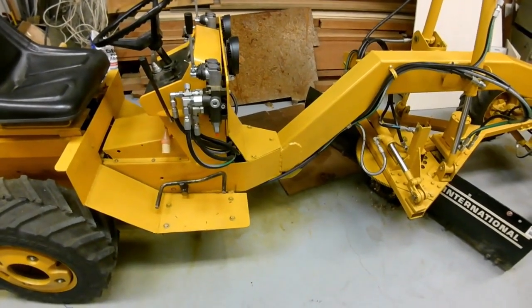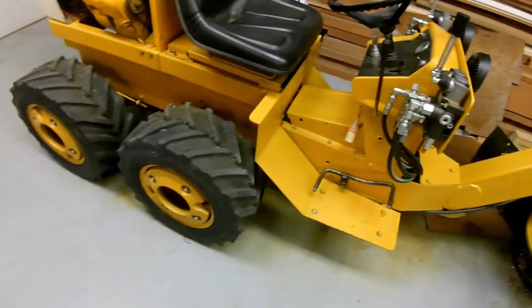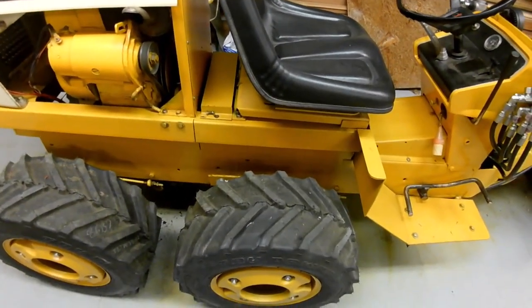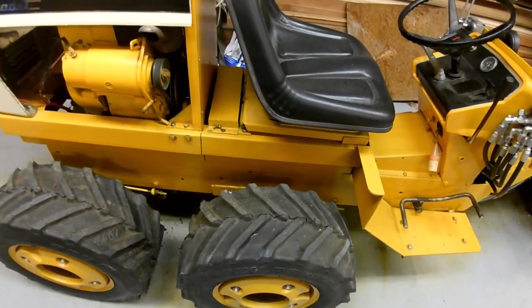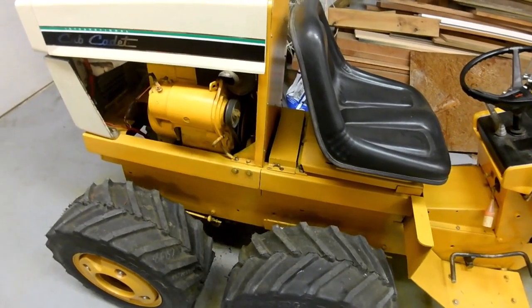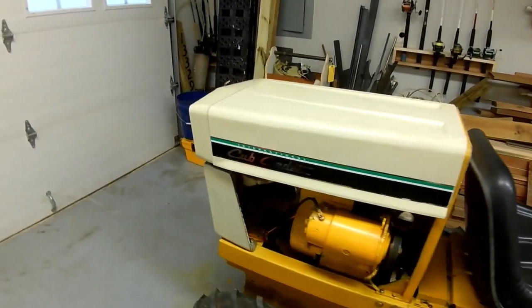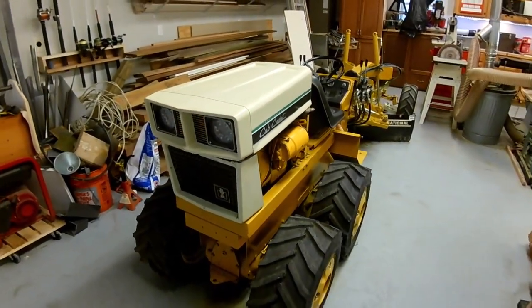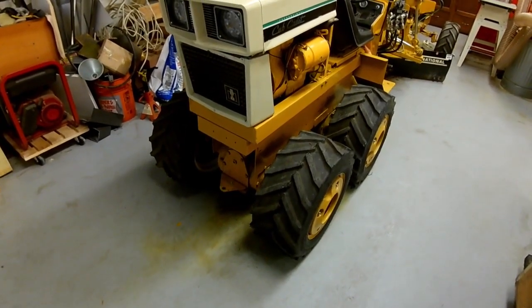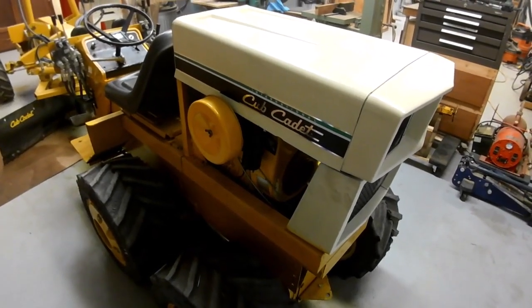The dash tower and dash are retained from the Cub Cadet, and from that point forward it's all been custom fabricated. The wheel wells and footsteps are custom fabricated. The original frame has been modified — additional height has been added with two-by-four rectangular structural tubing, which allows the engine to be mounted above the axles instead of in line with them. The front hood and grill assembly from the Cub Cadet is turned around and mounted here, as you might see on a motor grader. The machine also has a tow bar and tow point behind it.